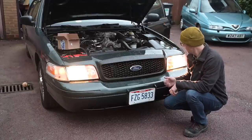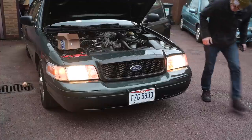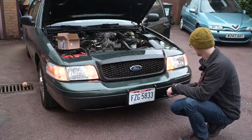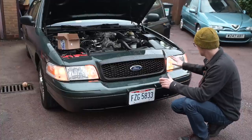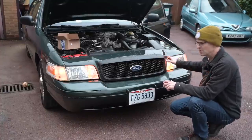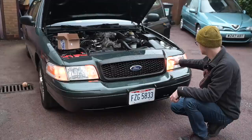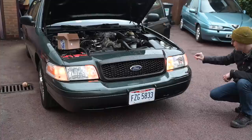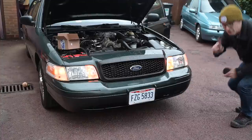I'll make sure the main beams work as well - seems bright, that should be good. So we're now at a full complement of working lights at the front of the car. One thing I'd like to look at with an auto electrician in the near future - not for the MOT as it should pass as is - is that there are no side marker indicators. If you're turning at a side junction, anyone driving along the road wouldn't be able to see what you're doing. It would be nice to wire one of the indicator flashes from the central indicators to the side markers so they blink in tandem.